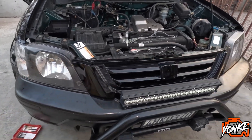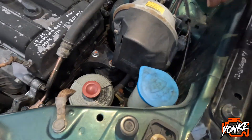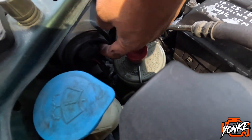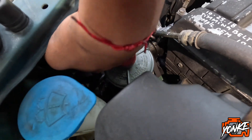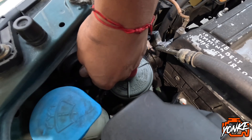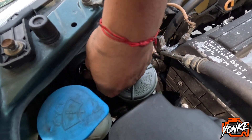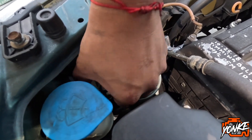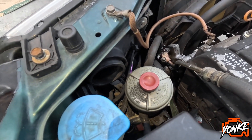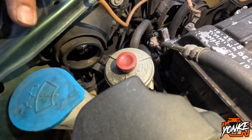We got this headlight in. Now on this side we're not gonna remove the grill or anything — we're not gonna remove the headlight at all. We're just gonna dig in here with our finger; it's gonna be a little tight but it's possible. So we're gonna pull this light bulb out — that's the plug — and we might struggle a little bit to install the new one because it's bigger than this one, but we're gonna get it done right now so we won't have to unbolt the whole front end of this car.